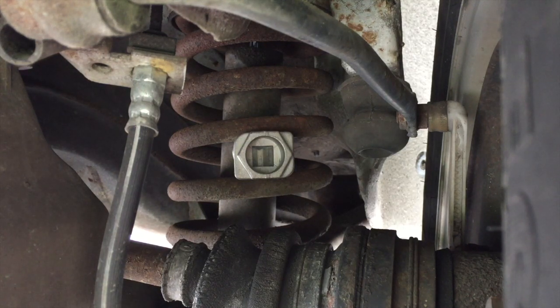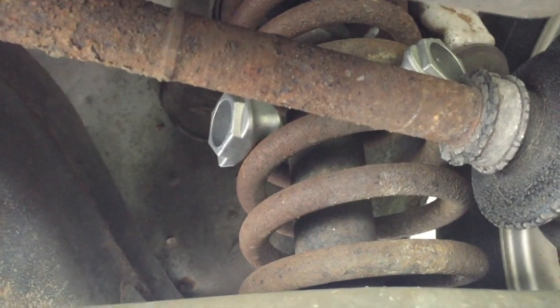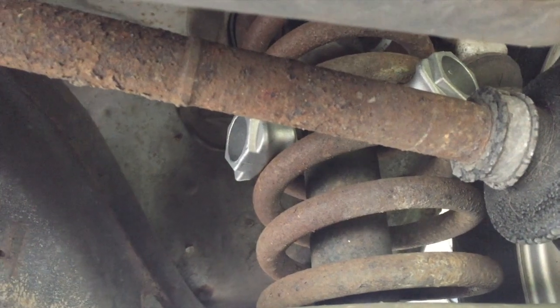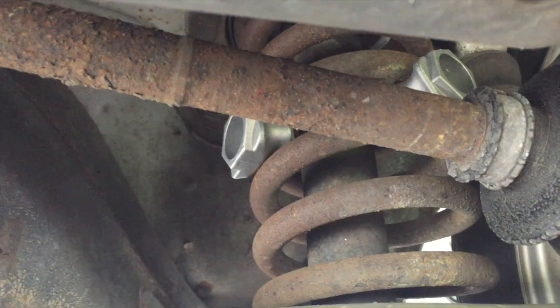The right way of doing it is removing your springs — you do need a special spring compressor for that. You also need to remove the shock. It's kind of like a mushrooming scope-creep project because there are all kinds of other rubber bushings you should be exchanging while you're at it, because that is typically the reason why it has a saggy bottom.